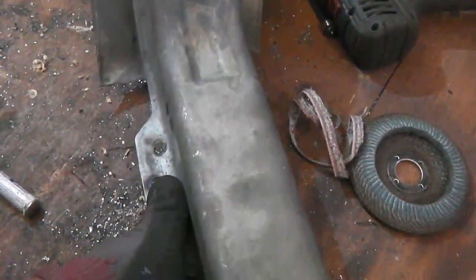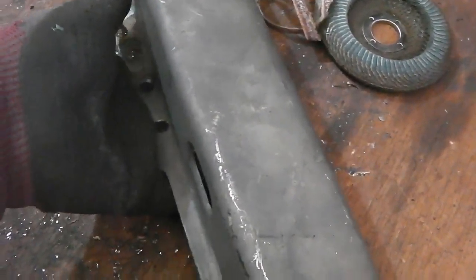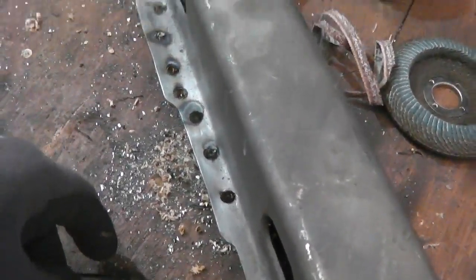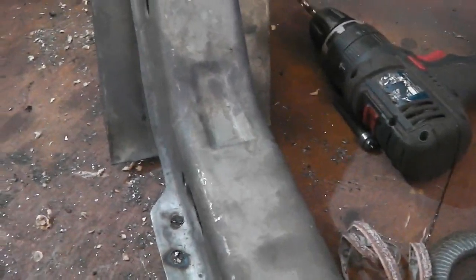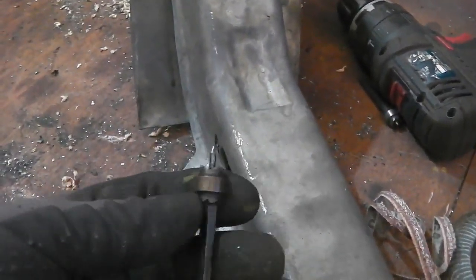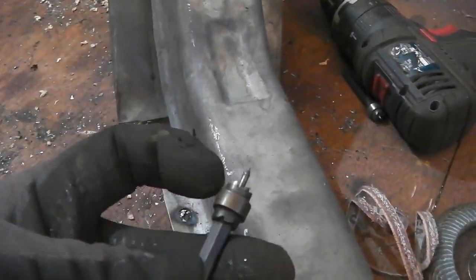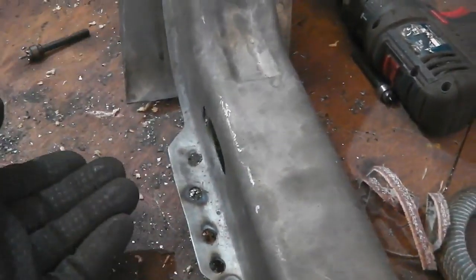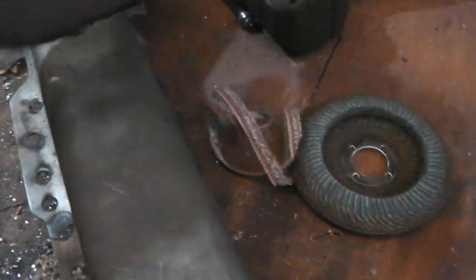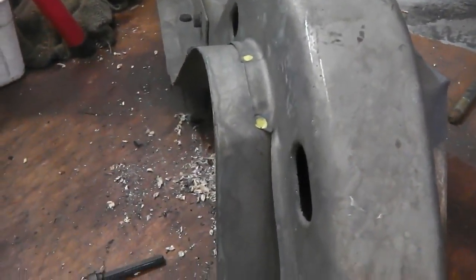Now, there's no need on this. This is the cross member for where the seat goes inside the car. There isn't much need to use these today on this because I'm not saving the panel at the back. I'll just be wearing these out at a tenner a time. You get actually double usage because you can spin this, flip this over. You see where my finger's at the back, you flip it. Kennedy, spot weld drill bit. Don't need to use it. Work on a wooden board here, and I'm using an 8mm cobalt bit. And I'm just marking and blasting straight through.